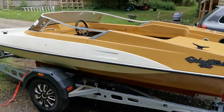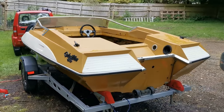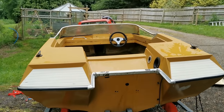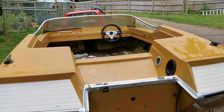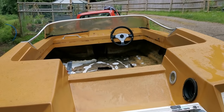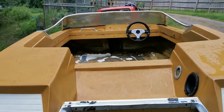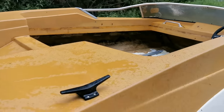Maybe get a start on doing the floors. I don't know what to use for stringers — there's lots of back and forth between people about what you should use. I have got a load of teak but it splits quite easily and it's heavy. Cedar's good, larch is quite good — both sort of water-repellent woods. I'll probably just use marine ply because it's easy to get hold of and it's got good uniform strength. Once it's encapsulated in fibreglass it's fine.